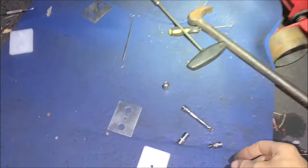Looking good. It can come down a little bit, about half as much as I brought it up. Yeah, we might adjust that a smidge. Yeah, I was looking at these. Okay, just a tip. Don't stay focused on the belt line, because those can sometimes be a little off anyway. Just stay focused on your original paint lines. That's what's important. You get those right, you should be correct in the box.